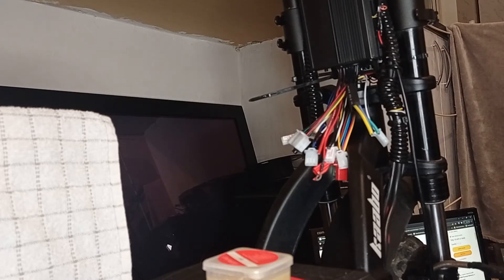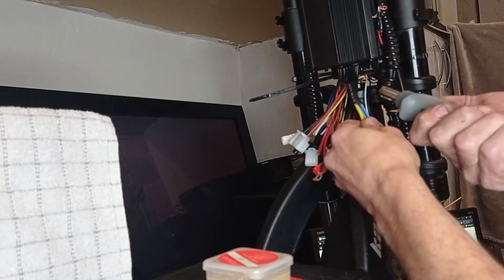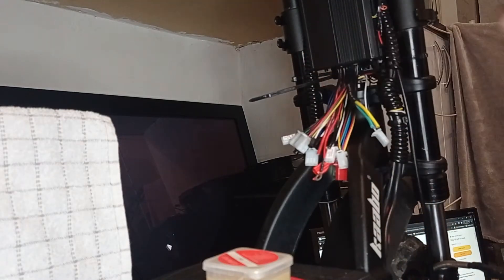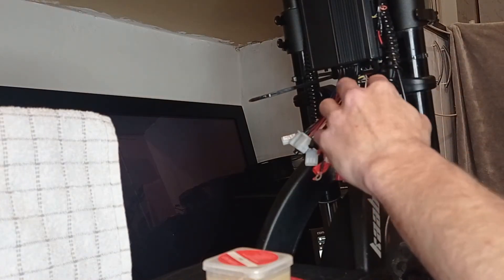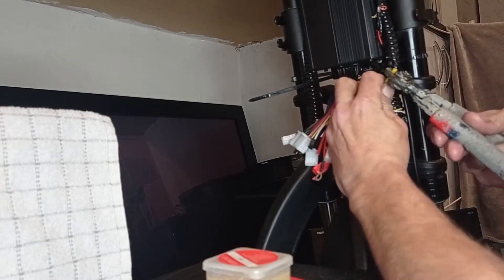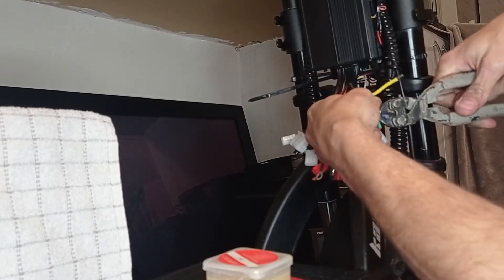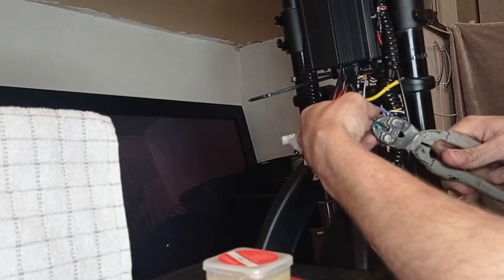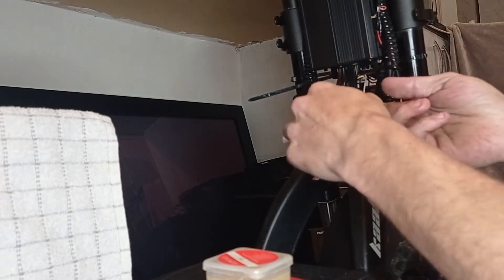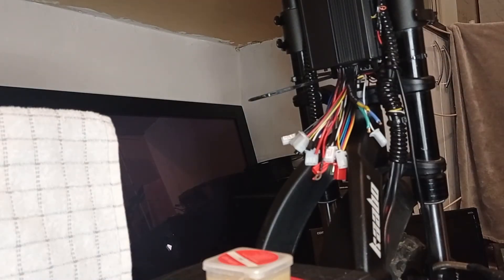When you look in your deck, I see a lot of burned phase cables — mainly not from modded controllers, but from the scooter carrying too much weight, like two people on it. It tends to burn out one of the connectors; it's mainly the connectors and not the cables themselves. That's why when I keep something for myself personally, every connector gets removed. It's a pain when it comes to swapping out a pad, but if you get used to doing it anyway it makes no difference. So we'll get our three phases done first.